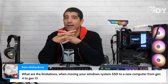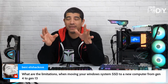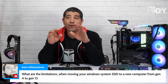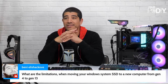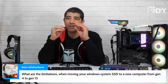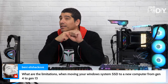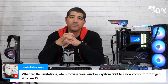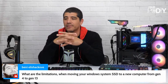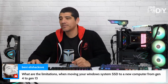I can tell you that a good percentage of users that RMA their systems do so because of issues with their operating system environment, and there tends to not be any hardware-based issues at all. So again, to ensure the best experience, I wouldn't do it. I would strongly recommend that you do a full clean install to have the best experience when it comes to stability, reliability, and critically, even performance. Even if you can make it work sometimes, because you'll have varying different things happening at the kernel level of the operating system, you can sometimes be losing performance. So like I said, to get the best experience, just do a clean install.